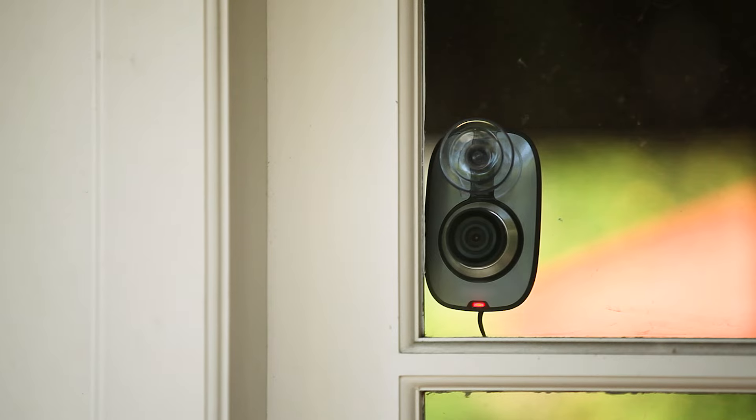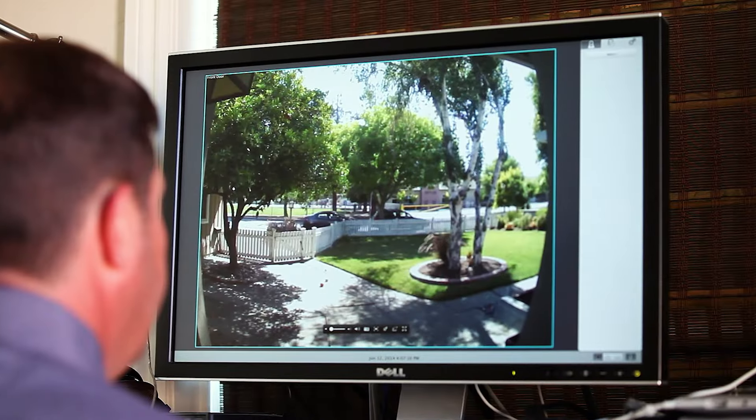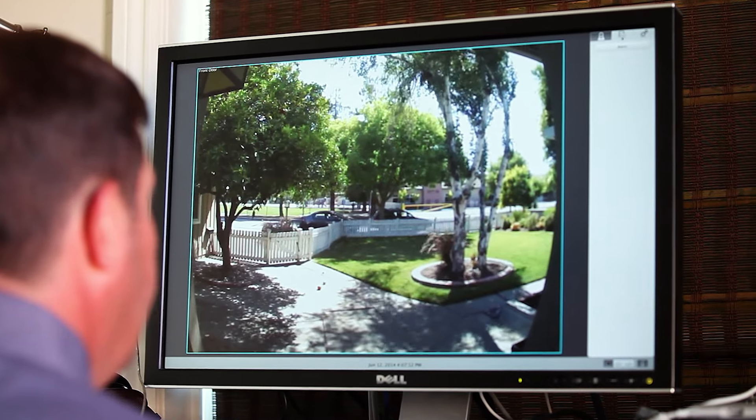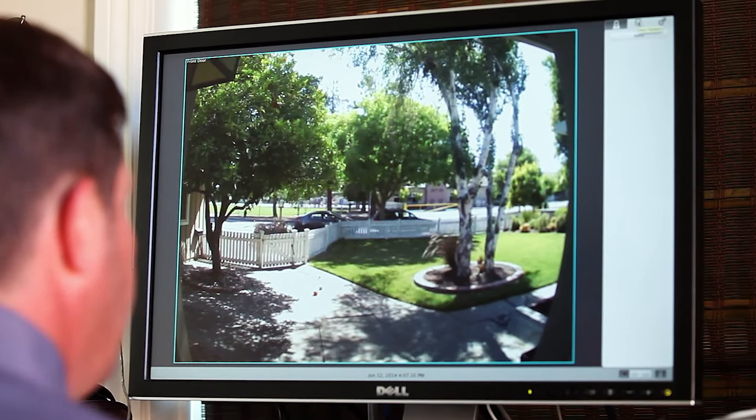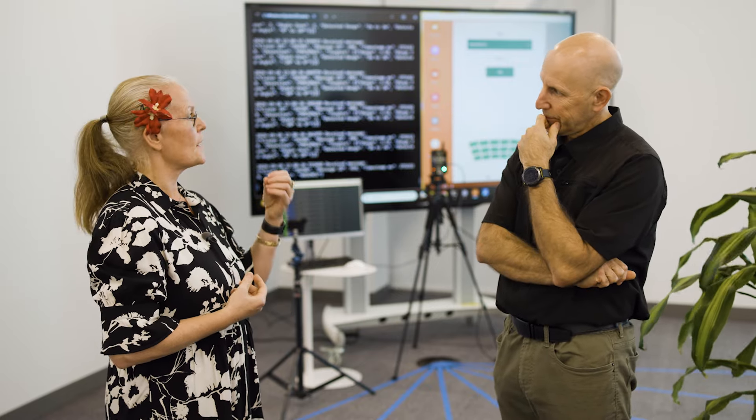We're trying to go against PIR, or passive infrared sensors. Those sensors literally detect anything and everything that is moving within the designated field of view, which consumes more energy because the camera turns on more often than it should — whether that's a moving plant, a tree, or an animal running through the field of view. That's not what you want when you're trying to save battery power on a battery-operated system.